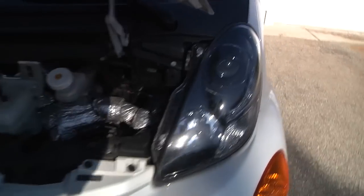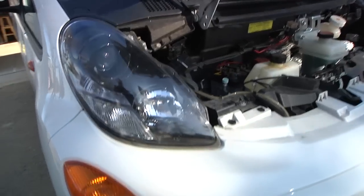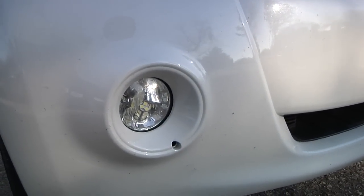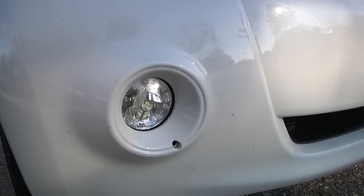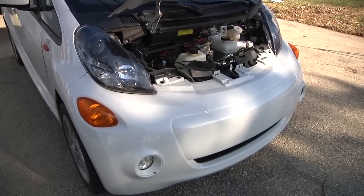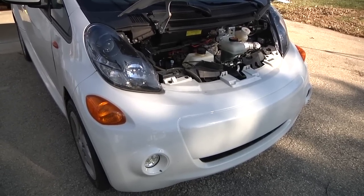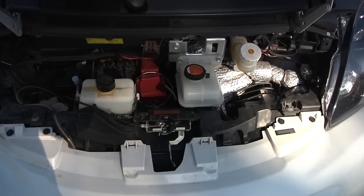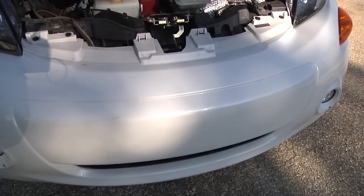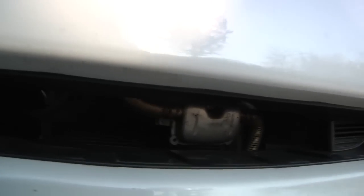The car has pretty good headlights — really nice projection beam headlights. I also upgraded those to LED. This car also has fog lights and daytime running lights; this is the higher trim level of the 2012 model year. I've got LED fog lights and headlights, and I kept the traditional incandescent high beams, figuring that if there was ever a big ice storm, the incandescents could melt ice off the headlights where LEDs may not. The aftermarket heater is mounted behind the front bumper cover — you can see a little of the muffler from the fuel-burning heater through the grill.